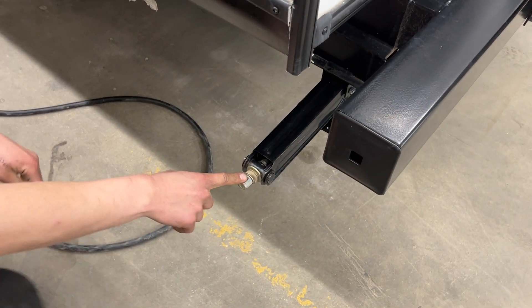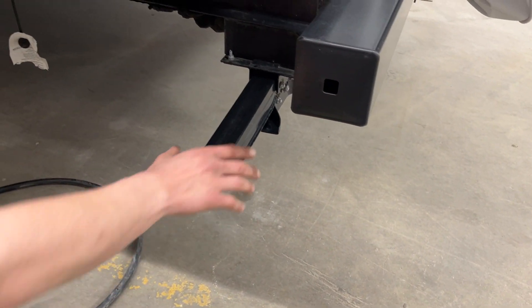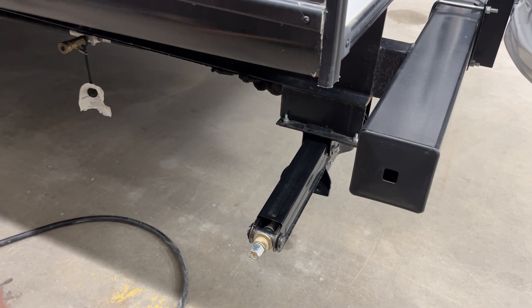In this corner, as well as each corner of the trailer, you're going to find these stabilizer jacks. All they do is run down, contact the ground, give it another turn or so to firm it up, and that'll get rid of any sort of bounce you see in the unit right now. Just keeps things firm while you're out camping.